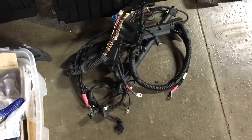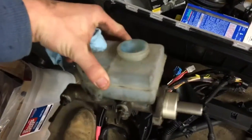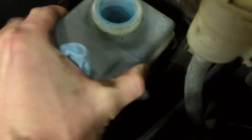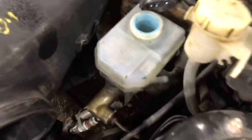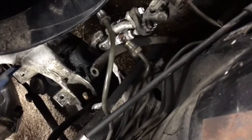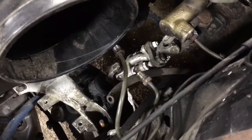There is the Z3M engine harness - brand new from BMW, it's $380 something dollars, really not too bad. Also a brand new 318iS master cylinder from BMW. The reservoir you do have to ditch - well, I think you have to ditch it. I do have the E34 remote reservoir setup I got with this car. Never mind, you can actually run a stock reservoir, so I'll probably end up going with that master cylinder - it fits really, really well. The brake hard lines I don't think will reach, so I'm probably going to have to get new ones, which kind of sucks.